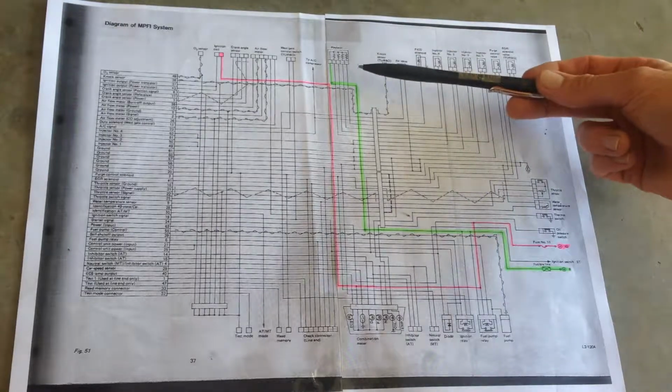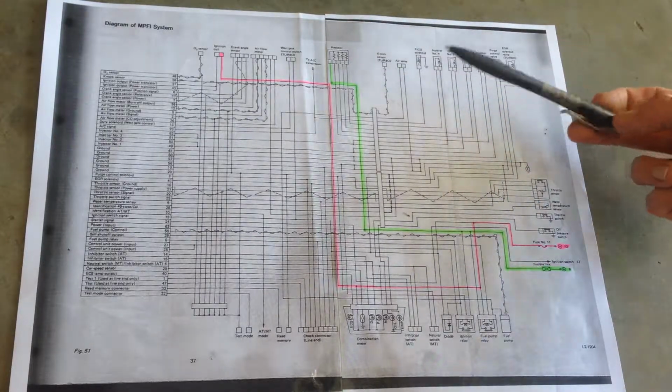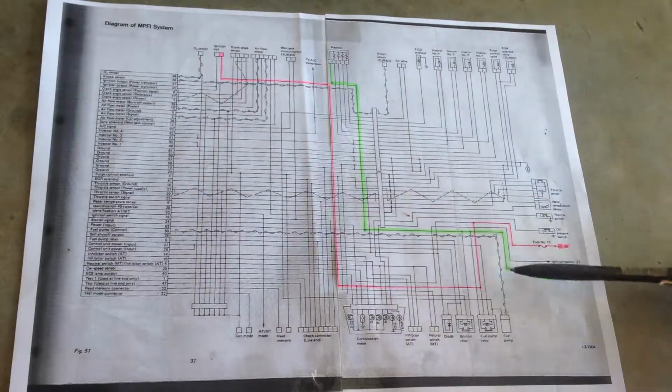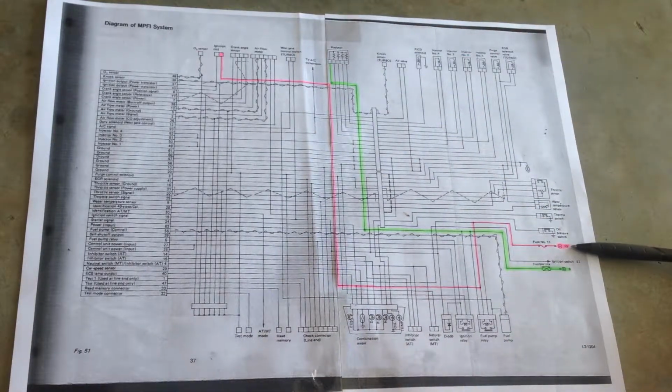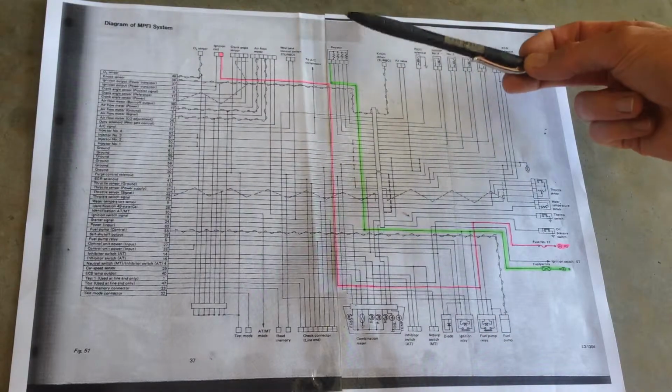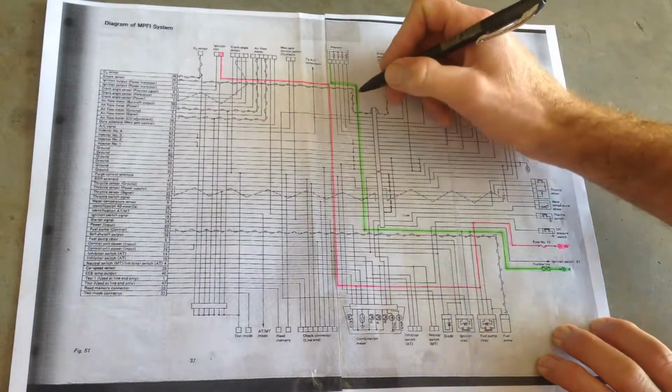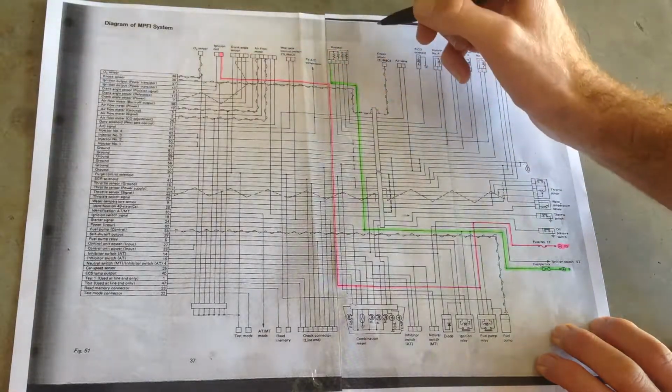So I need to change that because there's a chance they can feed back through the Megasquirt board and cause some problems. And the ignition coil is always powered when the key's on, righto? So what I'm going to do is set up relays on both of those two units, activated off the fuel pump, so that they're just running when the actual engine is running or the initial prime. Okay, so how I'm going to do that, I'm just going to intercept the wires just before both units.